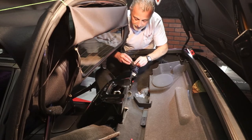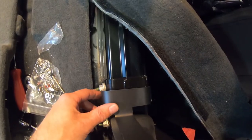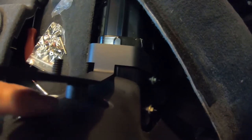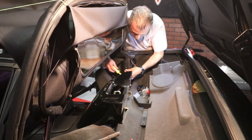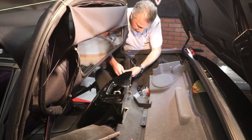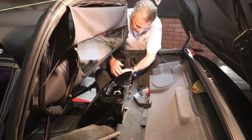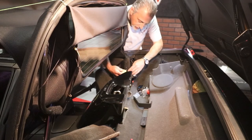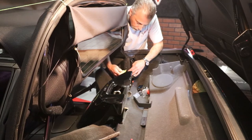About three quarters of an inch from there is what we're looking for. You can see that once this sits down in place, that standoff is going to fit right there in that slot. This is a 5/16 nut here, so I'm just going to put that little guy in like that and tighten it down. Now you don't want to over-tighten. It's going to get snug to your finger and you're going to tighten it up with a nut driver or a screwdriver. Don't reef it down so tight because it will break the plastic. You want it nice and snug, but don't totally crush it.